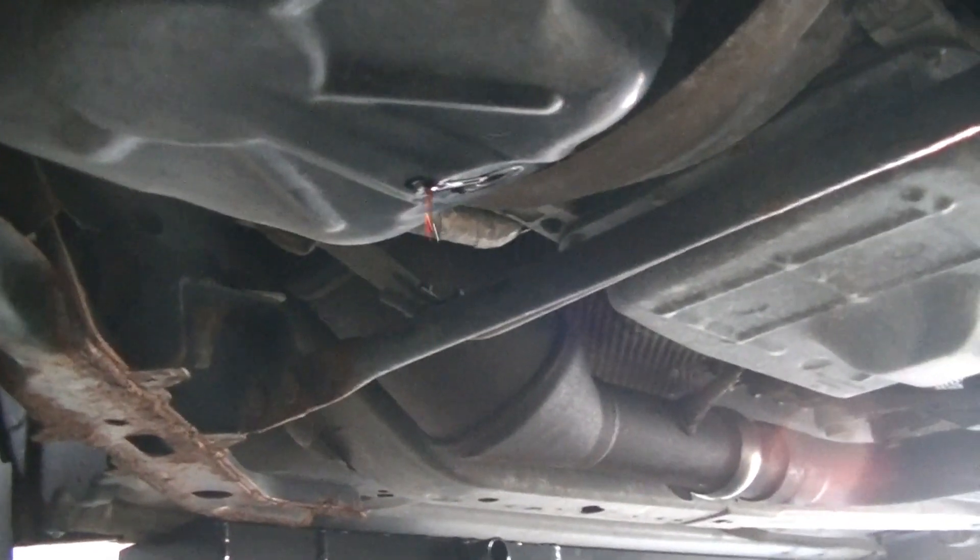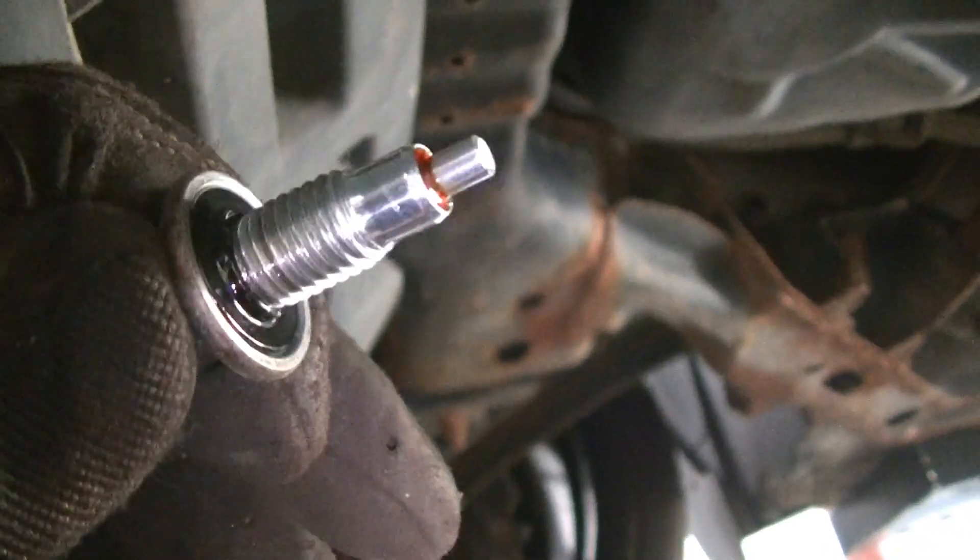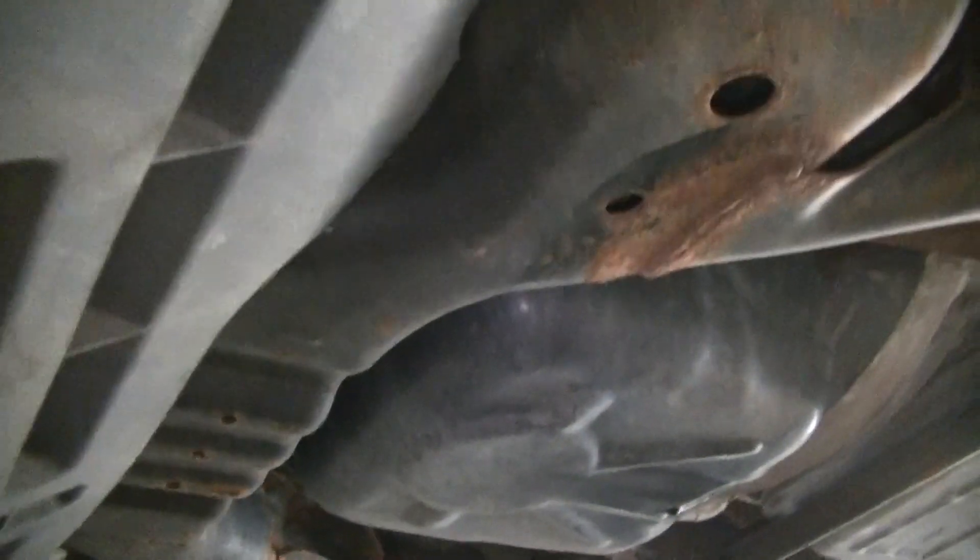We've let this drain while we were up here fixing some other stuff. I just fixed this underbody shield — it was kind of hanging down, some of the things were broken, so I fixed that. I went ahead and cleaned off the magnet on this magnetic drain plug, so I'm going to go ahead and put the drain plug back in. I already took the liberty of removing the three 8mm screws that hold this guy in — you're going to find one here, one here, and one there — and then this folds down revealing the oil filter. We're going to move the drain bucket over here, drain this oil filter, and then fill her up.